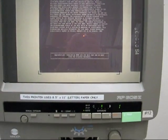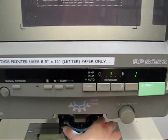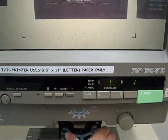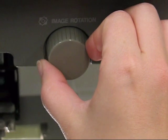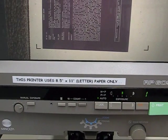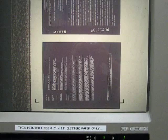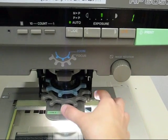If you are photocopying a lengthy document, you can save money by placing two frames on a page instead of one. Begin by adjusting the zoom to the smallest image on the screen. Next, use the rotation knob to turn the image 90 degrees counter-clockwise. Move the tray around until you have two frames seated within the margin screen. This will be a bit tricky as moving up and down and sideways are reversed. Once you have the frames lined up, you can zoom to get the best fit and focus as normal.